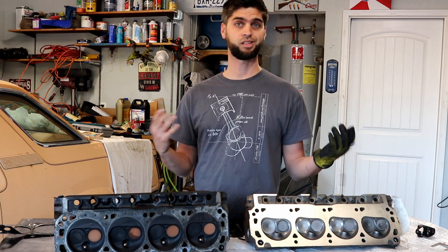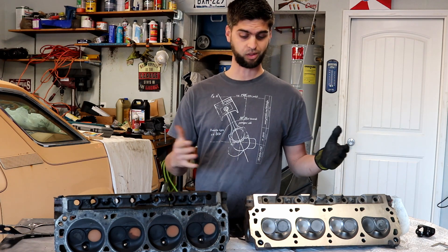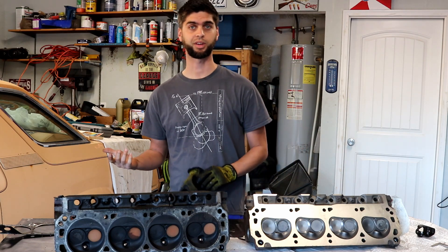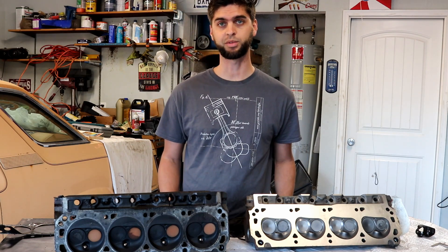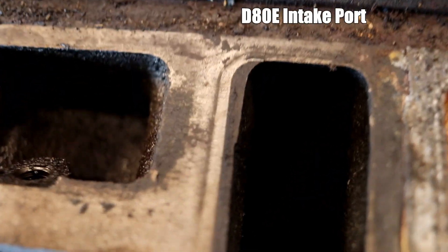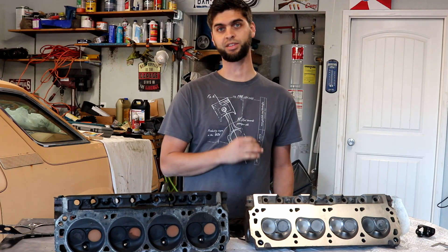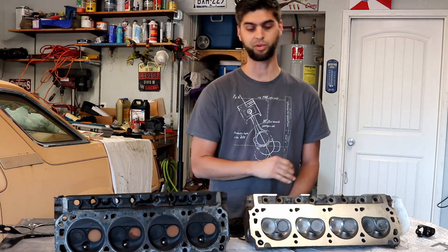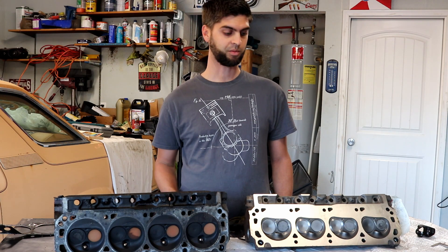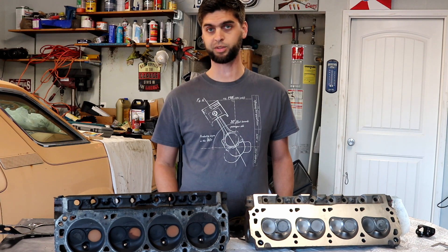I hope you enjoyed that and got to see a glimpse of what I might be picking up through all this. In some instances it seems like fractions of an inch — how much can that really add up to? But I think more importantly, just looking at the flow characteristics looking down both the exhaust port and the intake port of the GT40P head — that's got to be where most of the gains are going to come through, just the flow. The bigger diameters aren't going to hurt anything either; it's definitely going to be pulling in more air with the bigger intake valve. I'm excited to try it and see what's going to happen.